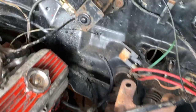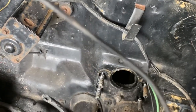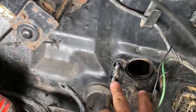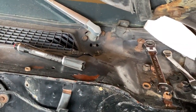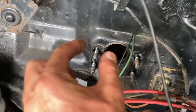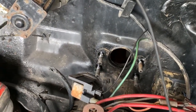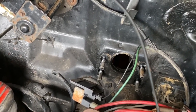Okay, so after struggling trying to get these nuts off these rear studs here, very confined space, I ended up doing a 9/16 ratcheting wrench. So I ended up buying a set of those. You know, cut down on probably 2 hours of just going one little minute click at a time with a normal wrench or an open box wrench. But anyway, got that off.